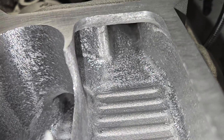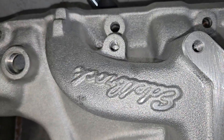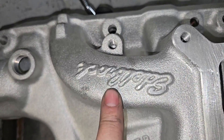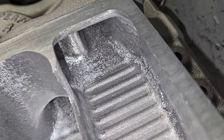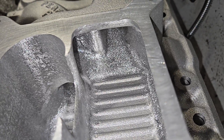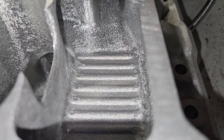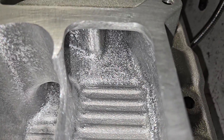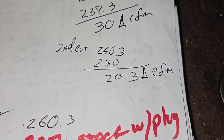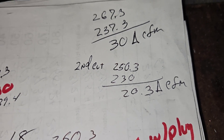I really don't see this having the same issue because there's a relatively long runner here - the foam probably packs up to about here but won't reach the plenum entrance and cause a problem. I definitely need to investigate why this particular runner is our low-flow guy. That's our delta CFM between best and worst.